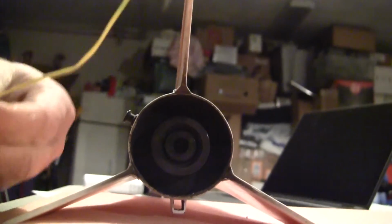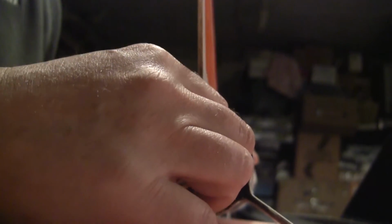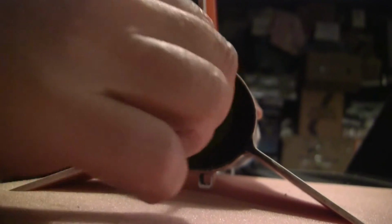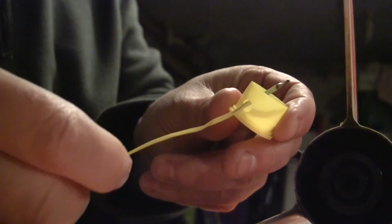So now, can you see this? We're getting the igniter, and we pinch it and you make it kind of straight, and you feed it up through the nozzle in the hole, and you keep going until it bottoms out. That's what you're trying to find, the bottom out point, because you want that black cap. So before you do that, take the protective cap and feed it from the outside hole through. There's a little hole in the side. Just let it kind of hang down.